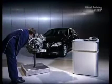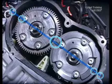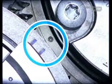Now check the position of the camshafts once more. These five points form an alignment. In contrast to the right intake camshaft, the line and the point marker do not form a line.